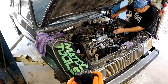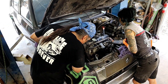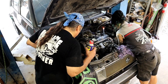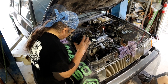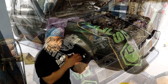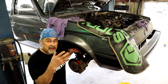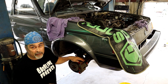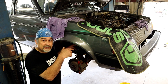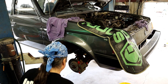So what do we have left? We've got to detach the transmission from the body, and the starter. We've got starter, shift linkage, clutch cable — look how cool it is, it's pretty much everything is out of the way. Motor mount in the front — oh my god, it's so simple. I love working on these versus modern cars. It will be out in just a little bit. We can pull the axles out. Everything on the top is undone, pretty straightforward besides a lot of corrosion from just sitting in Daytona Beach, Florida for a long time. We don't want to break anything, so we're going to pull the axles and drop the engine and transmission down from the bottom, the way the factory did it.